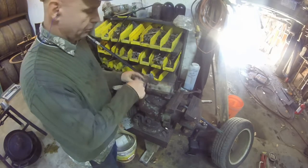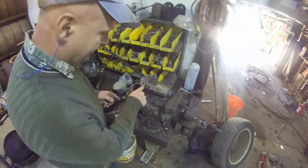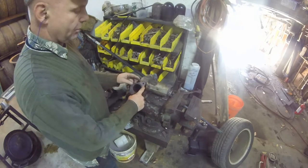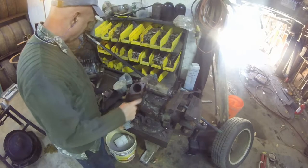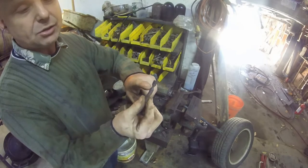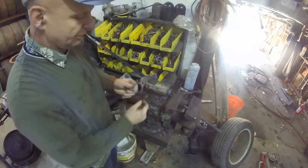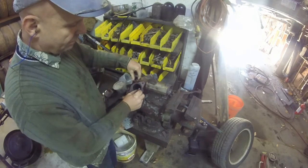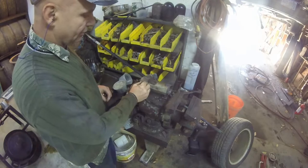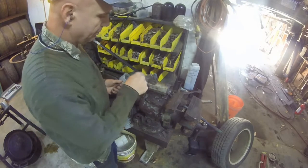This other side is really hard to get because it's stuck up right next to the frame rail. This is a stud — not a nut and bolt — and you can't press it out, you have to drill it out. But I put it in the vice, used my brazing tip, got it cherry red hot, put a set of vice grips on it, and slowly moved it back and forth for about five minutes while it was cherry red. Now I can just use a standard M10 stud and put a new one in.